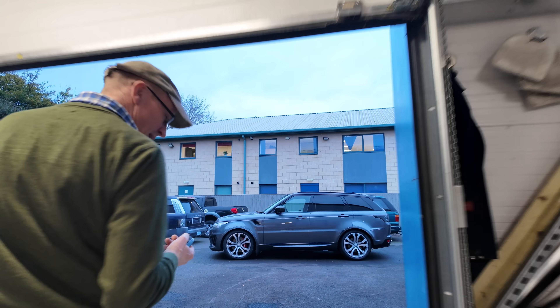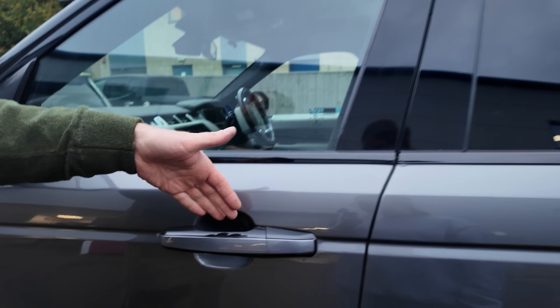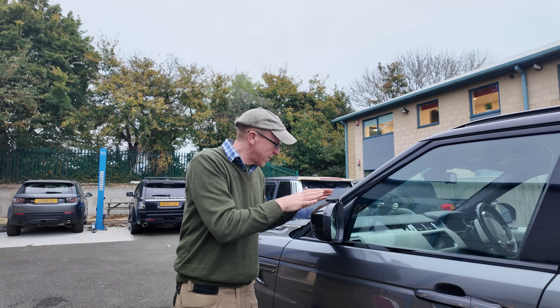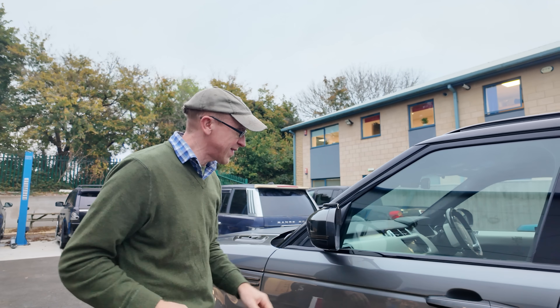The battery should be awake now, so let's test it. Lock the car as we walk to it — there we go, all locked. Put my hand to the handle — unlock, we're in. It all works perfectly. Now I'll lock the car and leave the key still for a few minutes to let it go to sleep. We did a trial at six minutes and it was asleep, but having just read the JLR letter it says the sleeping battery goes to sleep in three minutes.